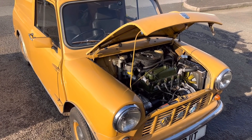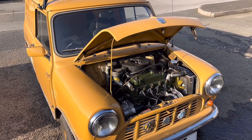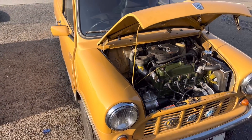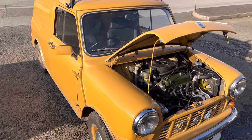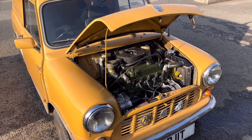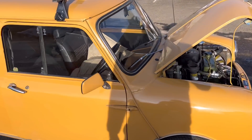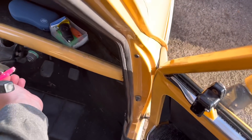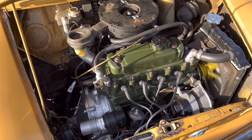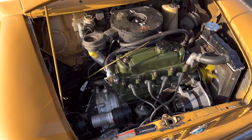We came to fire it up this morning — I fired it up, drove it around the block, and it was a little bit uneasy to get into first gear. Once you were driving it seemed okay, but when I got back and left it running, put it into neutral and went to go to first — no chance. Put it in reverse and it just stalls instantly. So we've checked the adjustment on the bottom of the clutch and it does appear there's some sort of leak in the system. Bob's going to come around tomorrow, have a look, and maybe replace the slave cylinder. Apart from that, the engine sounds sweet as a nut — if you know minis or little A-series engines, that's what they sound like, but this is particularly quiet.